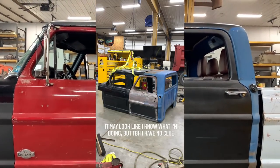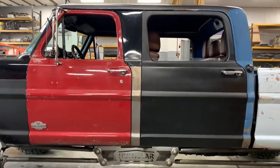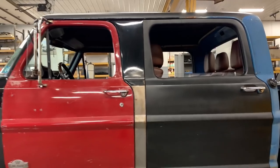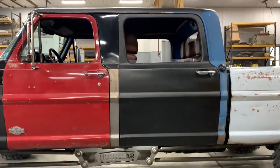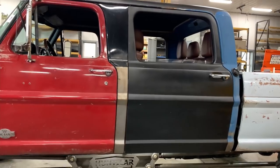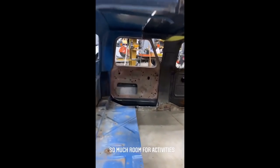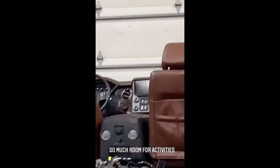I started by cutting the '68 cab and took a single cab and made them two together using the single cab door. I wish I wouldn't have used a single cab — I wish I would have used another crew cab. The roof lines did not match up with each other. When I go to repaint this thing, I'm going to cut the whole roof out and put a van roof in with the ribs to replace all that, because right now it's not 100% straight. I got it as best as I could, but eventually figured it wasn't worth it.